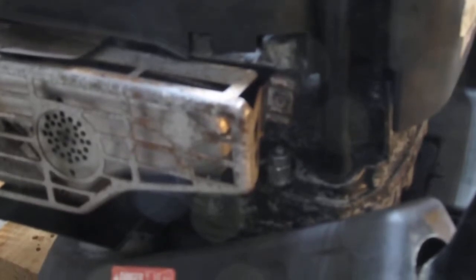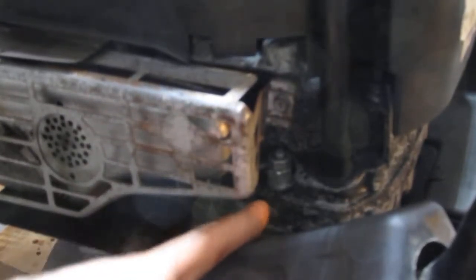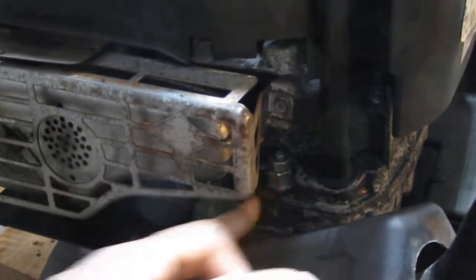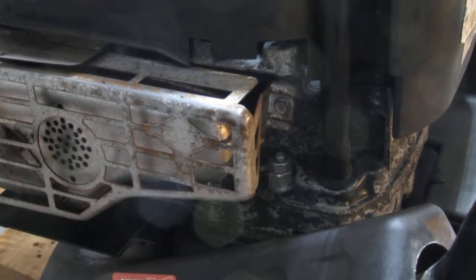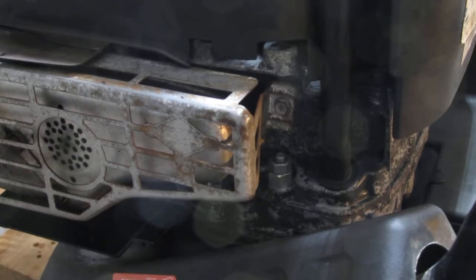And well, I looked underneath and I just happened to see the water pump. The leg cracked from right there. I thought it cracked because it was loose from the one that I didn't attach the other bolt to, but that's not the condition. So we have a cracked water pump leg, and we got to try to fix that or see if it's salvageable.